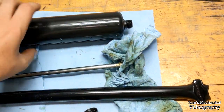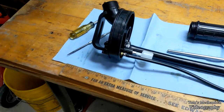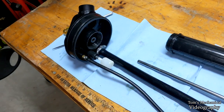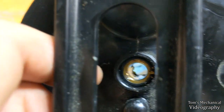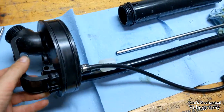All that crud has wiped out this o-ring, which is probably the crux of all my problems. It also washed a lot of grease out of there. I already came in here and greased this guy up again with some wheel bearing grease, and that helped it out a fair bit, but not all the way. So I need to get that o-ring out of there because it is wiped and does not protrude out of that bushing anymore.